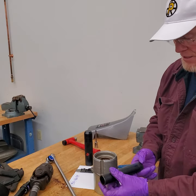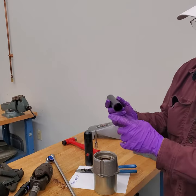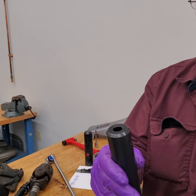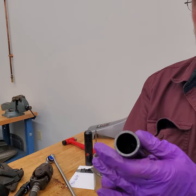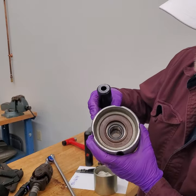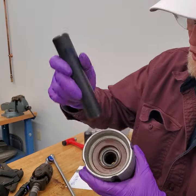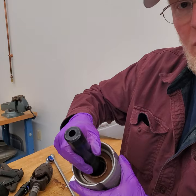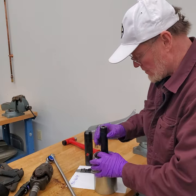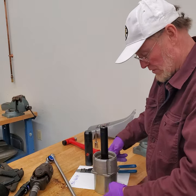You need the 884-266 tool from the book. It looks like a piece of pipe but it's a special tool. One end is tapered — that's the press side. The other end is open — that's the side that goes on the gear. This will fit inside onto the gear; the dark section is the gear. You've got to have the right tool for this. Put that on a press, line it up, and press the gear out.